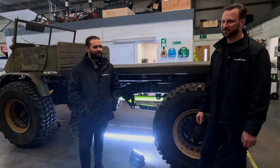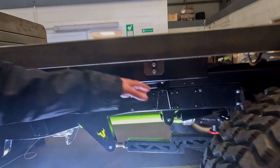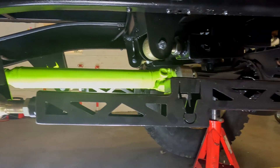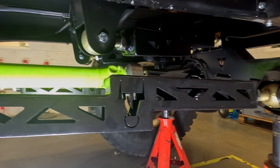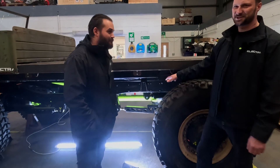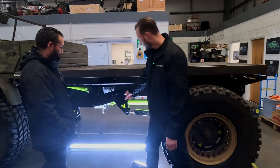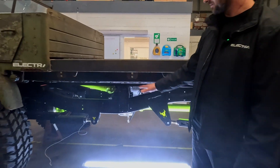The four-link has been fully designed and custom made for this vehicle. When designing it we went on the journey with Ben discussing how we want the vehicle to perform, covering all the anti-squat angles — there is real science behind it. We have lost some ground clearance; the transfer box is sitting a bit low, and we recognise that. We'd probably set it up differently again to avoid losing so much clearance.